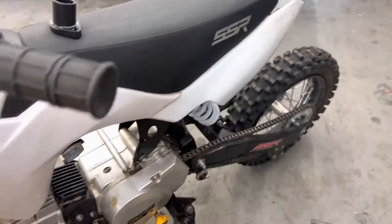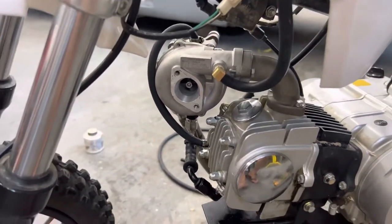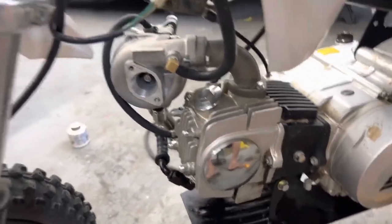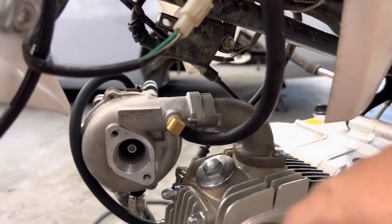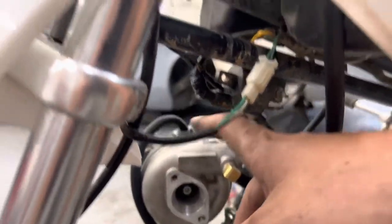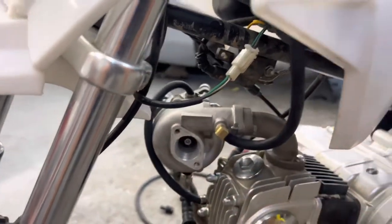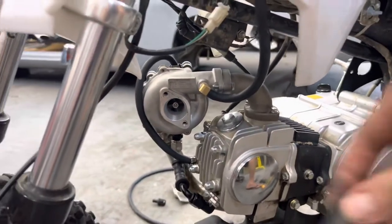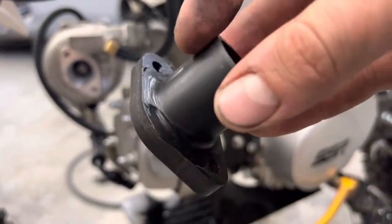The only problem is with that flange — you have to buy a flange kit. The kit is about 50 dollars. It comes with the drain flange for the turbo, this flange here, even though I just bolted this directly to the intake elbow. It also comes with the dump flange in the back where you make your dump pipe for the exhaust coming out of the turbo, and some block-off plates. I took the flange from the kit and welded a piece of 120-wall one-and-a-quarter inch tubing right here.